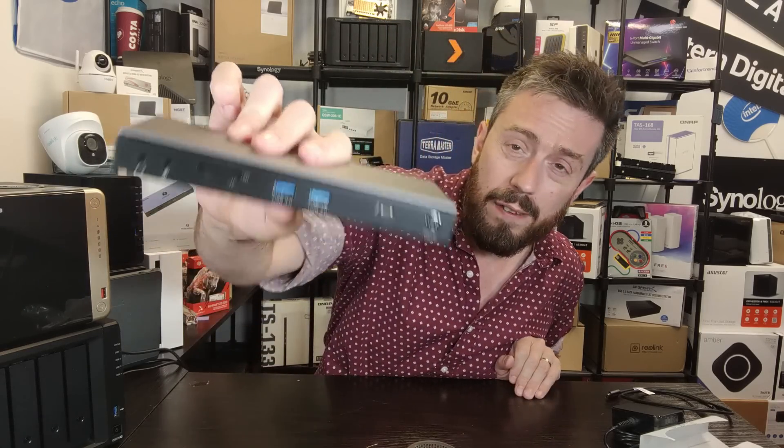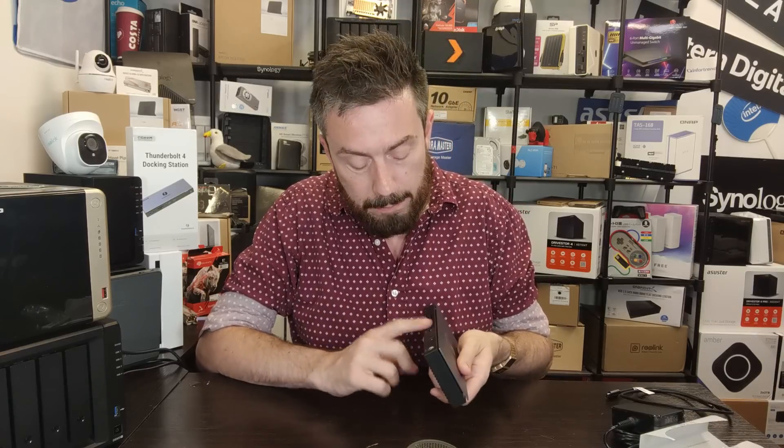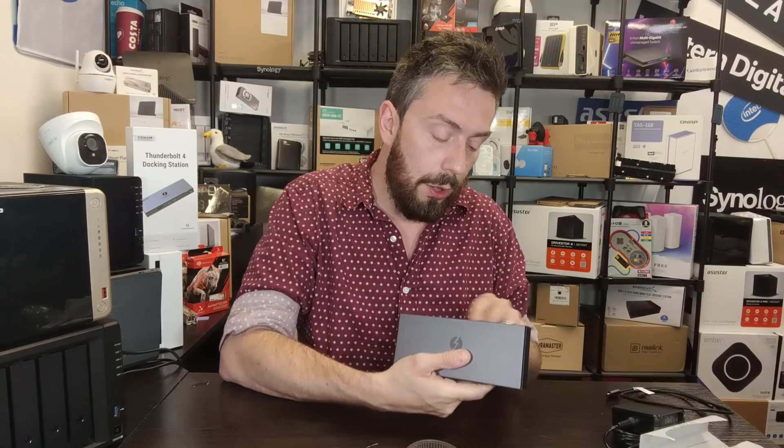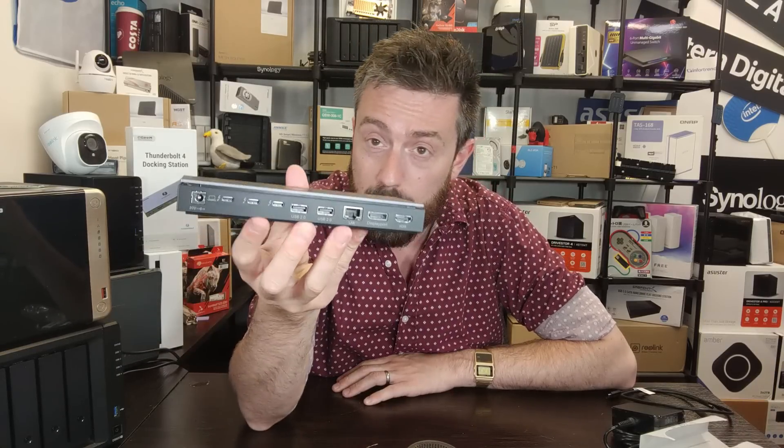That means you can connect this in the middle of your desk to your Thunderbolt laptop or MacBook and then connect three independent monitors. You can also connect a KVM keyboard, video, and mouse via two USB ports. Worth highlighting: these are USB 3.2 Gen 1 ports at 5 gigabits per second. Given you've already got all those USB-C ports outputting USB, having USB 3.2 Gen 1 here is a little underwhelming, but better to have them than not — particularly for legacy Type-A connections.